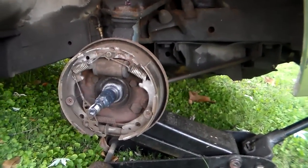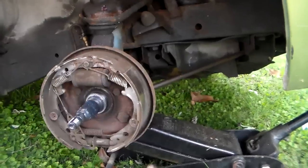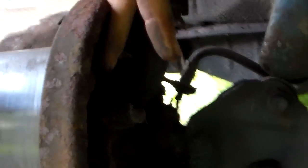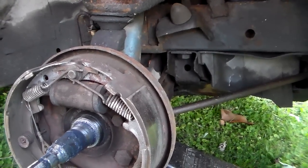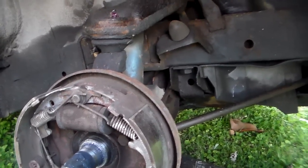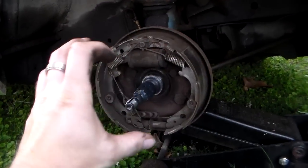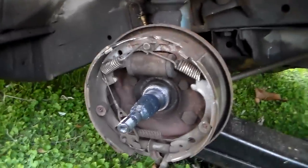So I did another test — not really necessary since I knew the brake was working and kind of letting off, but I went ahead and popped the bleeder screw loose, pumped the brakes, and used my prop rod to hold the brake pedal down — my one-man brake bleeding procedure. Then I came in and opened that bleeder screw, and it actually opened. I thought I'd snap it off, but it spit fluid out. That tells me the brakes are getting fluid pressure. But the dragging was still a red flag.